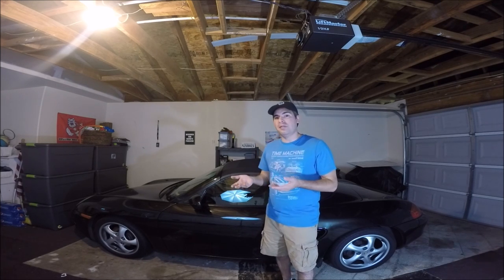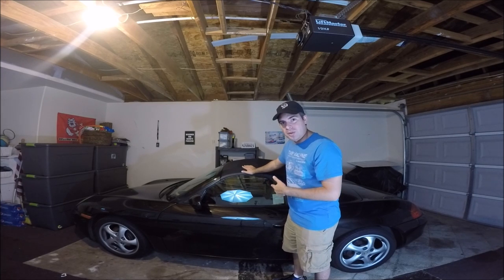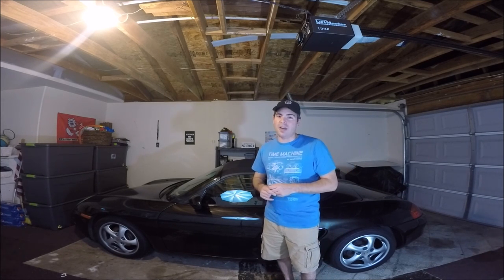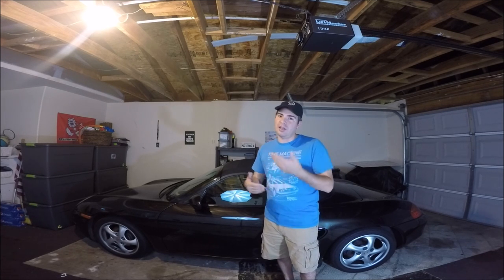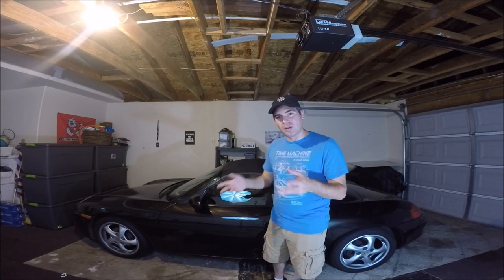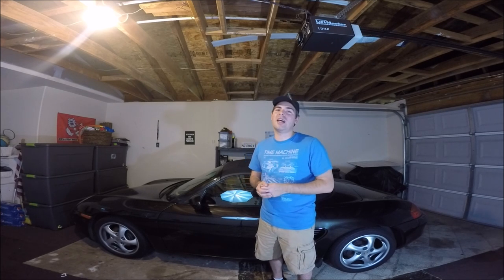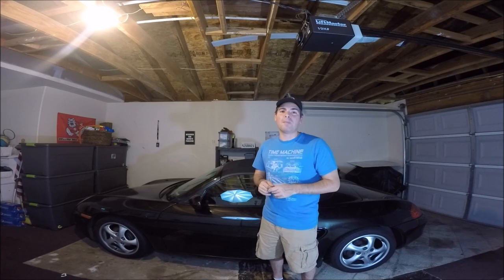Figuring that it's about $550, for about $150 more, as long as you do the labor yourself, you can have a glass window and not have to worry about the plastic cracking again or fading. The only disadvantage to the glass window is that it is smaller so it can fit inside without breaking. You do get a smaller view, but if you've driven a Boxster like this, there are a lot of things blocking your view anyway. The one we've got also has a window defroster that hooks up to the side mirror defrosters — same system, so you can do it right inside the car.